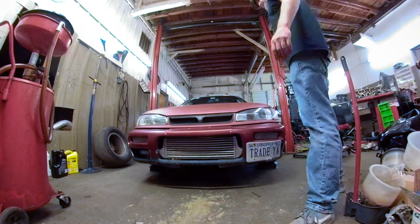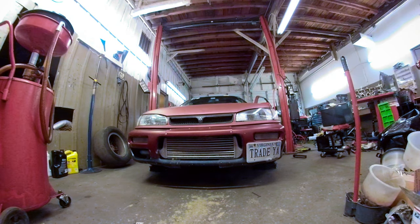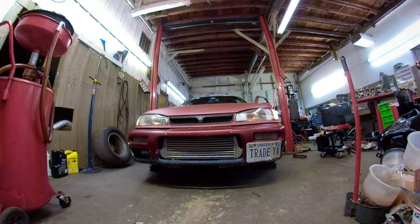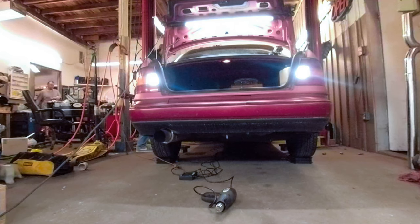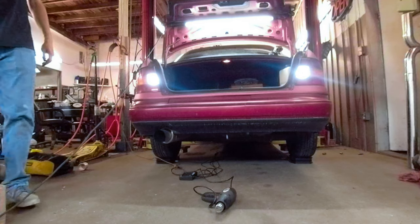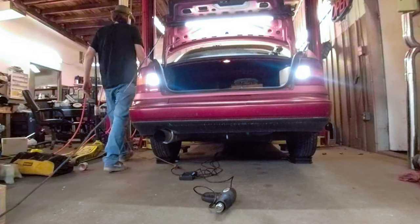They're gonna do all of this. Make sure every light works, with the headlights on or off, and that they blink no matter which relay does all the blinking. High beams, low beams, third brake light bulb, license plate bulbs, check them all. You need to check this on both the front and the back of the car and do the same routine because opened or closed short circuits can affect other bulbs.